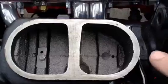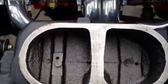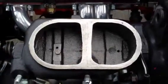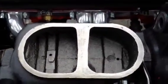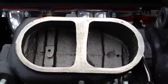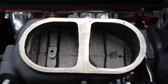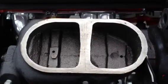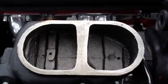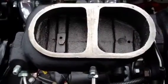See the little holes? That one there and that one there? Those are called emergency bleed ports and what those ports do is two things. One is they equalize the ambient atmospheric pressure in the brake lines and where you are at that time, either in the mountains or down on the beach. The second thing they do is they let little bits of air out that are trapped in the master cylinder that cannot make it out of the brake lines.